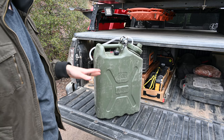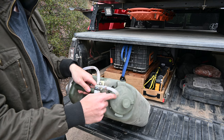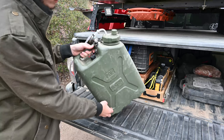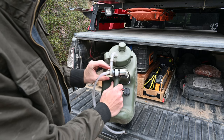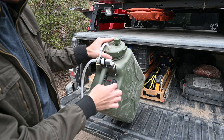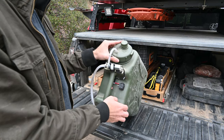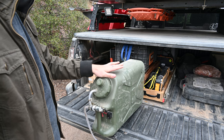I know this looks adequately busted, but I guarantee it's clean on the inside. This is a five-gallon water tank I got online. The vent valve has a hose run through it and epoxied on the outside to make it watertight, and that hose goes to the very bottom so it always has a source to pull from. On the front, I epoxied a culinary water pump directly to the tank, soldered to an on/off switch that goes directly to the battery. When I flick the switch, I get running water; flick it off, it stops. On a three-day overland trip a month ago, I only used maybe a quarter of the tank — I was thoroughly impressed with the capacity.